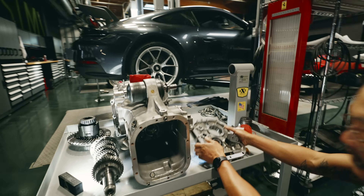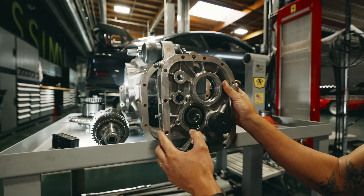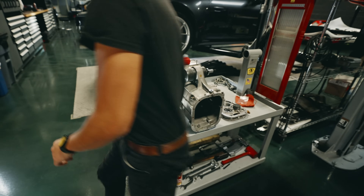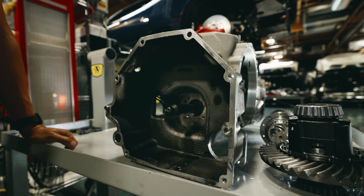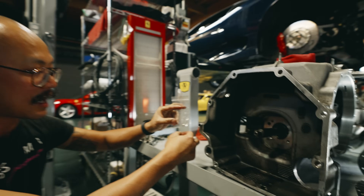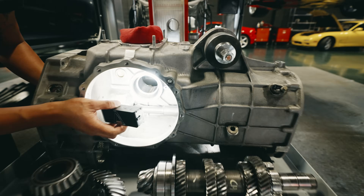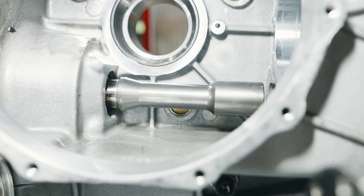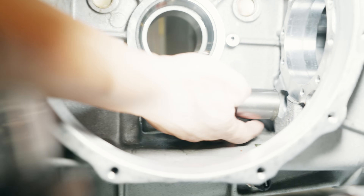So that sits here on the end. All the gears go in there — most of the gears. This goes in the back. You have a few other gears here for reverse, you have an idler gear. Pump here. Rear of the car. Front of the car. Clutch and pressure plate go through here and attaches to the engine. When we were looking around to try to figure out exactly where this particle was, the closest thing we were able to find was in here. Some play is normal. You can see how much play is on this input shaft. There is another bearing from the primary shaft that goes in there that kind of stabilizes this, but we have signs of it hitting on the casing here.